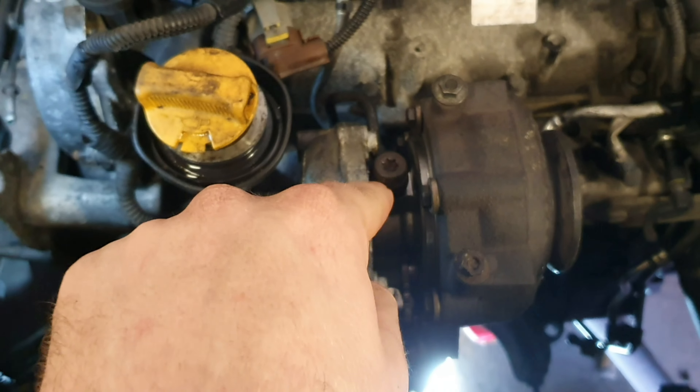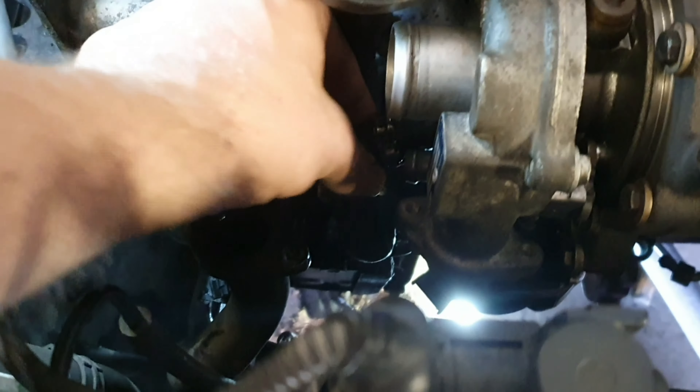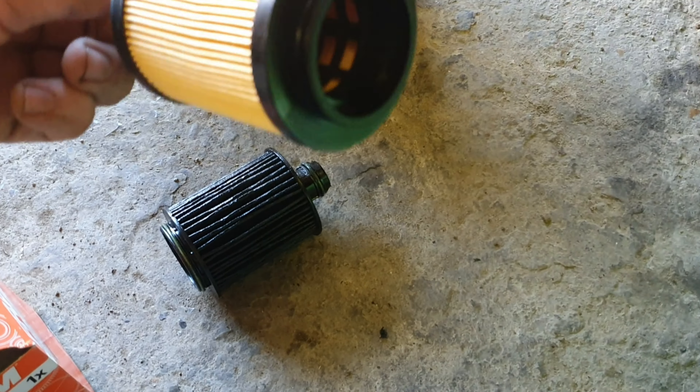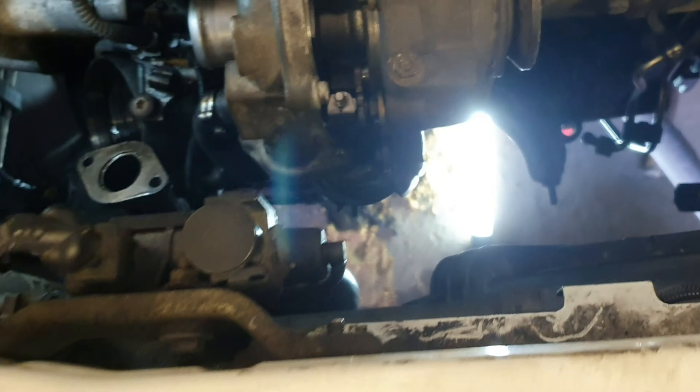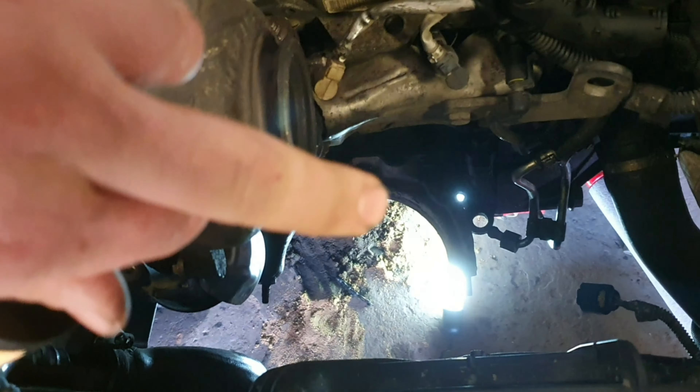There's a little slit there so I might have to trim that back — see how we get on. The turbo is now in place, we've got the oil pickup pipe on, that's all tightened up. I'm going to shave a little bit off of that while I'm here. I'll get the new oil filter in — just show you where that is. That's the old one, and there we have a brand new one. We'll get that put in now and connect the intercooler pipe up and get the catalytic converter put back in.